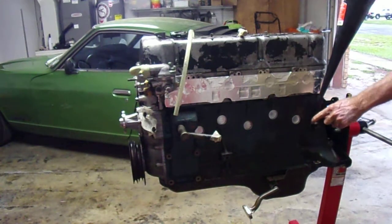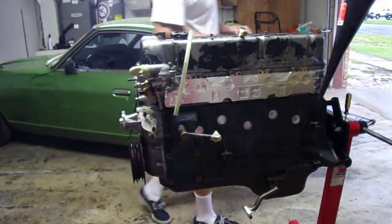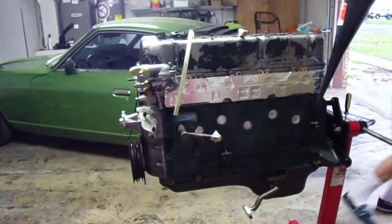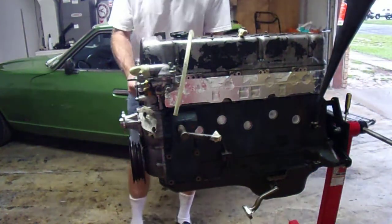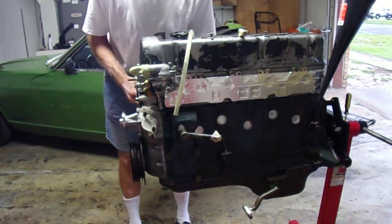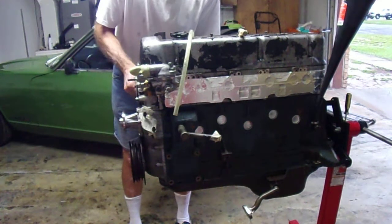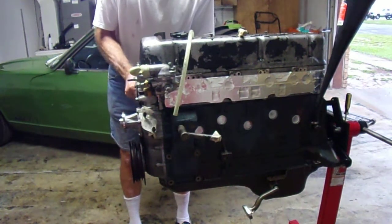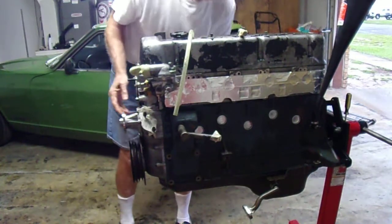Alright, so this is the only entry point. Ooh, I took the cover off there. I probably ought to cover that back up. Hold on. Stand by. So I'm going to take this little rubber thumb, cover up the water inlet. I basically want to see the WD-40 come all the way up into the clear sight tube. That's how I know I've got it all the way in. Then I'll dump it all out. Yes, I'll be scrapping all that WD-40, I don't care. It's not that expensive. Alright, so that guy's sealed up.